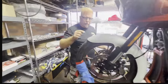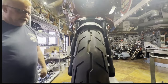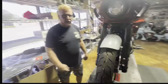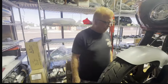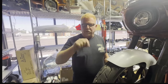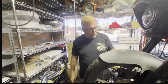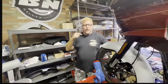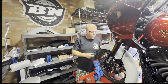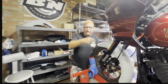Now if you look, the front fender is dead on — lots of space on both sides, fender sits nice and centered over the tire. That was just a little additional tip: if it's just not coming into adjustment, sometimes when a painter paints your fender they'll get paint inside the holes, so it's always good to clean them out. And on our inverted fork adapter brackets, they're laser cut and sometimes it's just a really tight fit, so giving everything a little bit more room makes adjusting it that much easier. Thanks for watching, thanks for choosing our products. Have a great day.